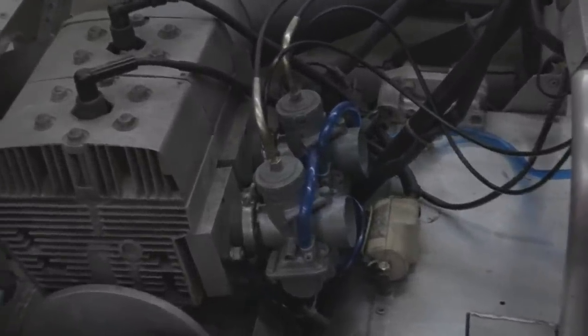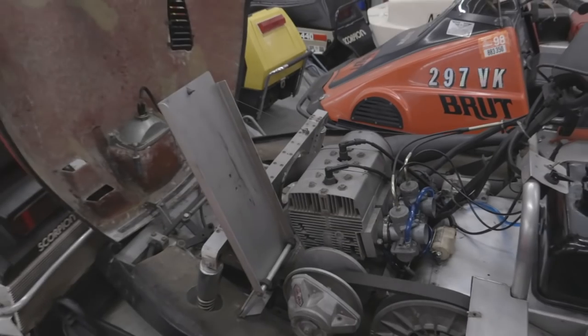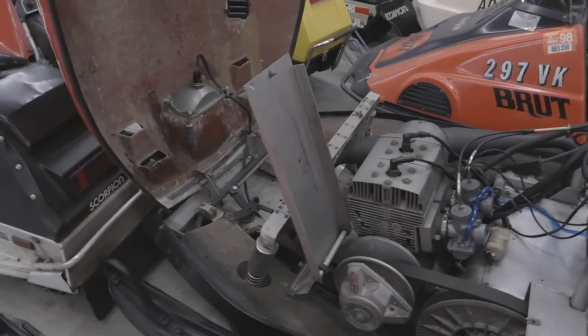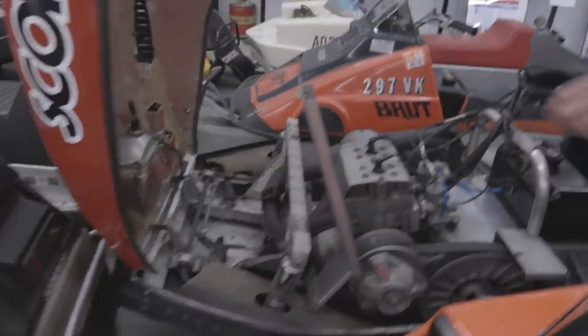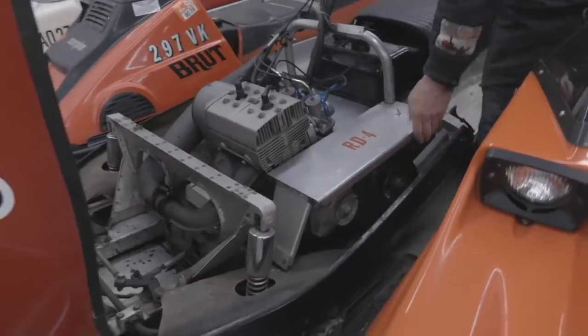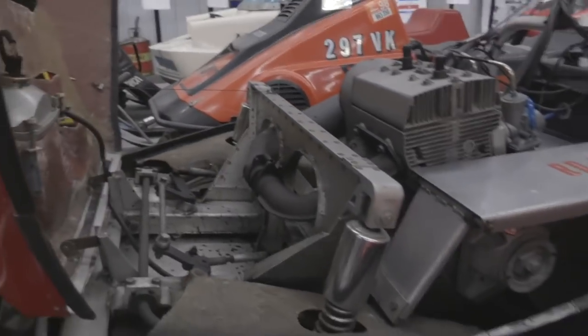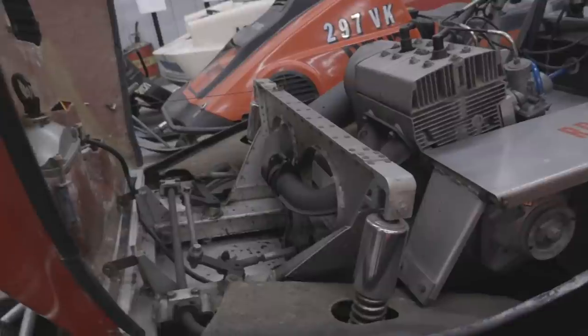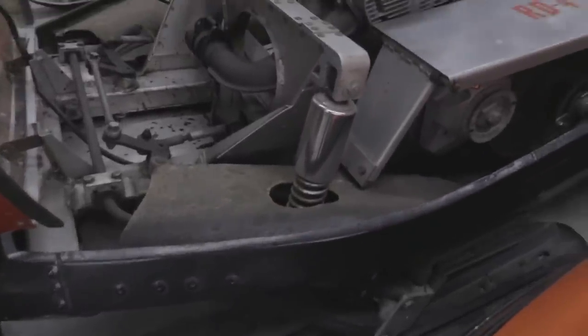Dan and Dave did. This one here is direct drive. See how big the driven is? Mm-hmm. And it goes right to the drive shaft. This has got a Cuyuna motor, Mikuni carburetors with CDI ignition. All aluminum chassis, slide rail suspension. Still have a trailing arm. It's kind of a trailing arm, but it fades back. It's an independent front end.